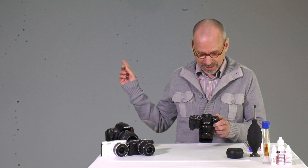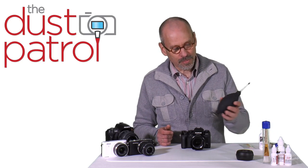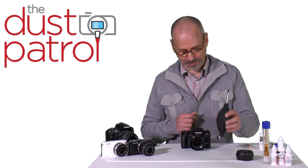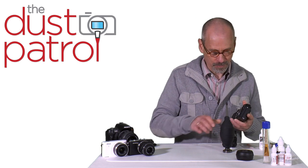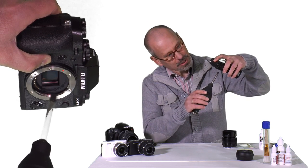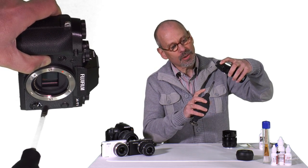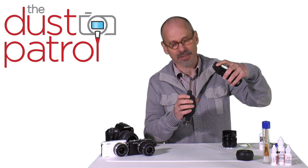On the test picture here I can see there's dust which has to be removed. We always start with a blower, preferably one with an inlet air filter. I remove the lens from the body, hold the camera upside down so dust will fall down, and blow into the camera. Make sure that you do not enter the camera with the nozzle. The nozzle may not touch the CCD.